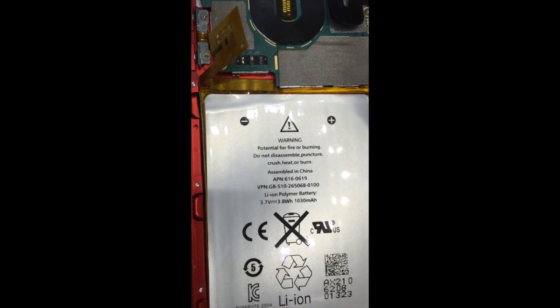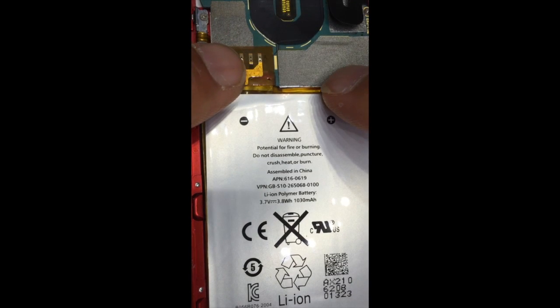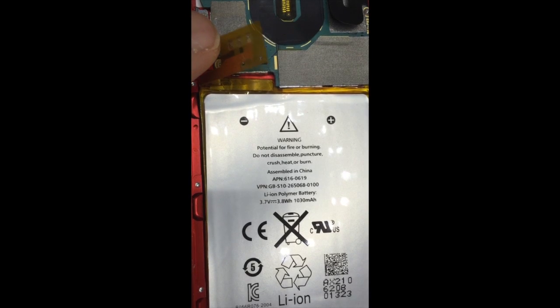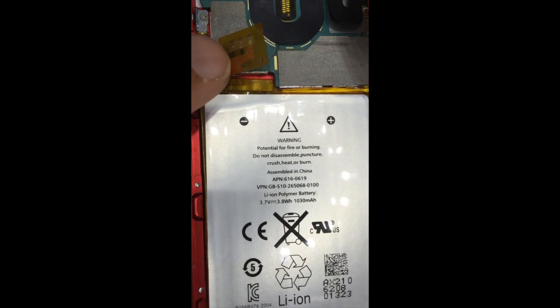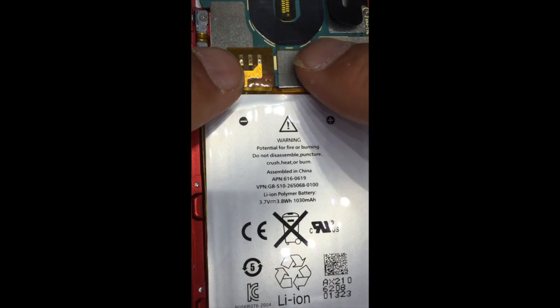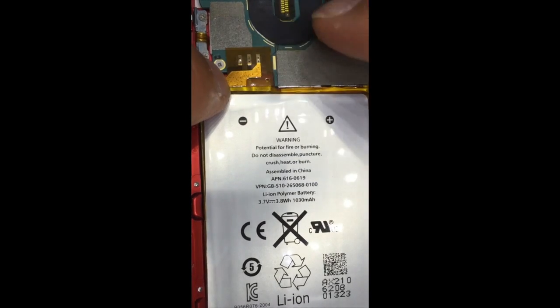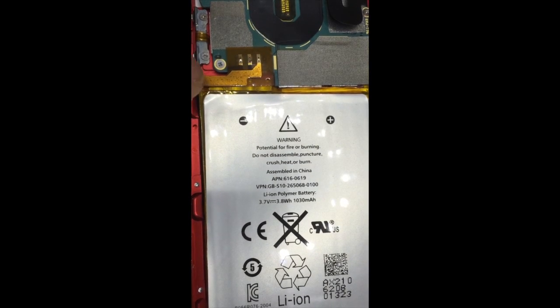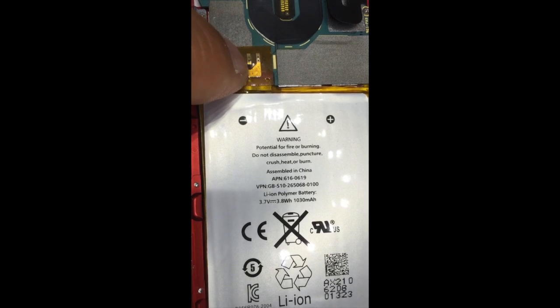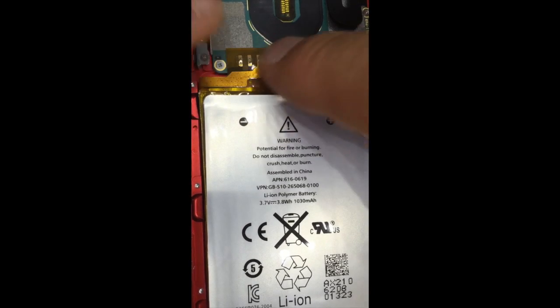Okay, it's pretty much lined up. You have to make sure it's fairly well lined up. I'm just blowing on it because I don't feel like going to the basement to get my heat gun, but alcohol evaporates quickly, so I'm not going to worry too much about it at this point. I'm going to put the pad down, take a good look at it, make sure it's in the proper place, and it looks good. We're ready to solder it back into place.